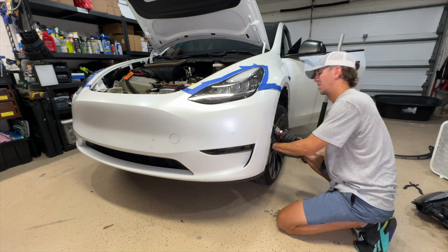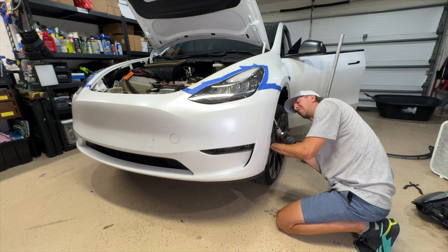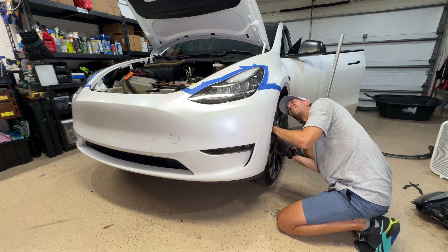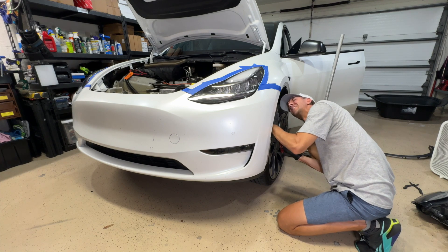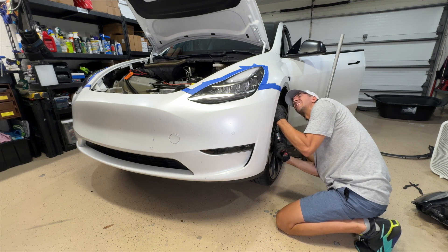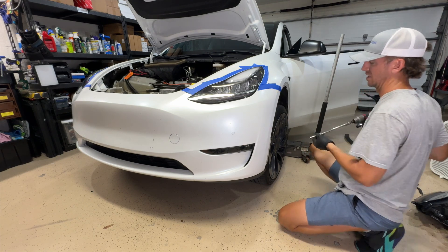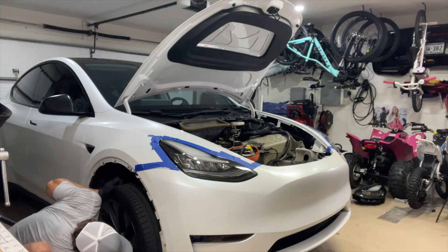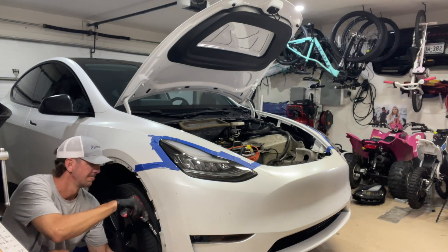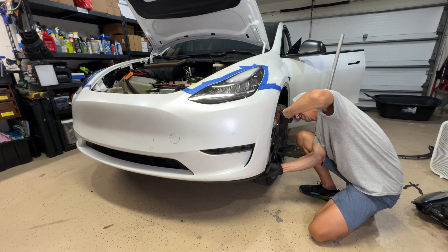Put the plastic clip in there, and now I'm going to tighten those two screws — both 10 millimeters. This is easier to do with a really long extension, kind of like what I'm using there. I also have a couple of wobbly extensions — makes it a little bit easier. Now I'm going to put that one that needs to come out on the outside of that fender there. Come back over to the other side and tighten up the 10 millimeter nut that goes on the stud that comes through that lower valance — same on both sides, one on both sides.